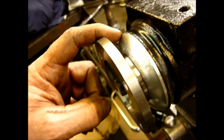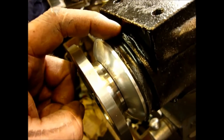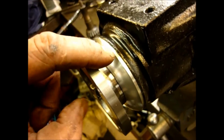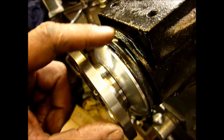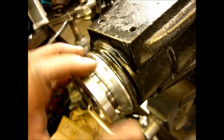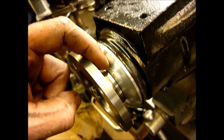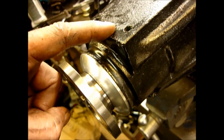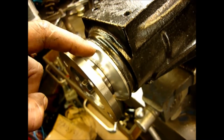The OD is accurate to 0.01 of a millimetre. This is a Land Rover casing, and it's not. It's accurate to whatever they fancied when it came out the casting, and this piece here where this aluminium flange sits on can cause problems, and also with the various amounts of internal movement you can have, all of those things add up. This is wonderfully accurate, you can have 100 of these off the CNC, they're all exactly the same. You won't find two Land Rover casings the same. So although this is a DIY fit, please be aware you may have to do a little bit of fettling.